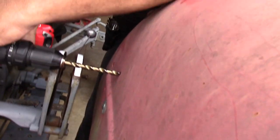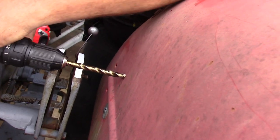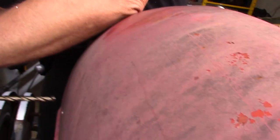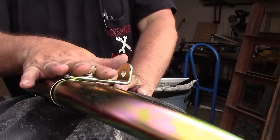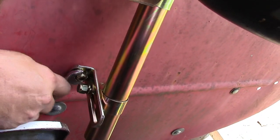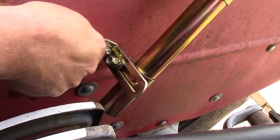That's all part of MacGyver. We'll start by drilling our hole here. It goes without saying — don't slam through there and drill a hole in your tire, that would suck. Now we'll get one of our bolts started in there, snug it up, and kind of hold everything else in place while we position this one. We'll use a level to make sure our thing is plumb. I've got my ratchet on the other side of the fender here. We'll get this thing snugged up.